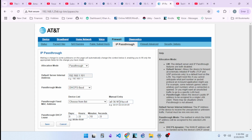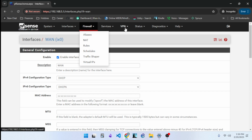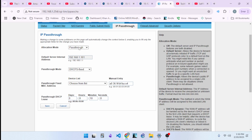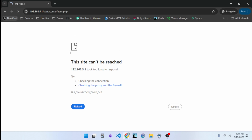You have to select your LAN interface MAC address, which you can see if you go down to status, interfaces. Well, let me enable pass through, and then it should work. So you have to know which interface it is. At the beginning of the guide, Louis Rossmann guides you through how to know which is which. So that is in the guide, knowing which interface has which MAC address. Okay, so now that pass through is configured, I can plug in and go to wired.